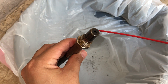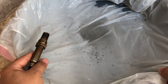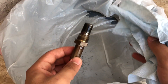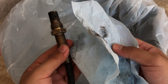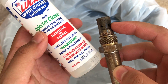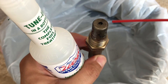Make sure to clean the top of the sensor as well. Look at all the carbon that was inside this sensor. Once you clean the sensor, wipe the head off — look how dirty the sensor was. Keep cleaning the sensor until all the injector product is out. You don't want any of that product still inside after leaving it soaking for 6 to 7 hours. Use your straw to make sure to clean every single hole around the sensor, including the top hole.